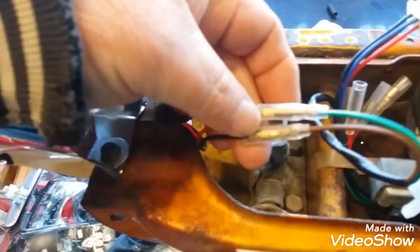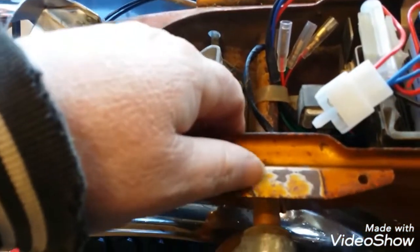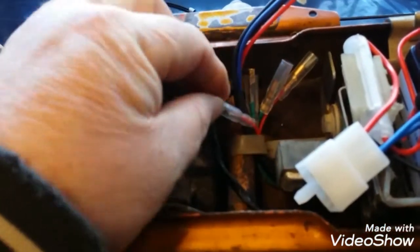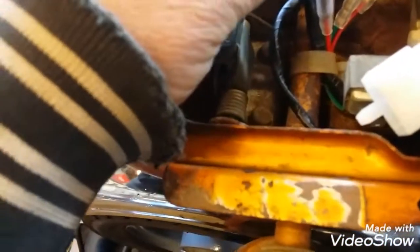Well, progress is slow but steady. We got the taillight connected okay here. This actually plugged into the brand new factory harness that I put in, so that was easy. I had run down to the auto parts store trying to get bullet connectors to fit these, and I wasn't very successful. I got what they had, but they don't fit. They are too big.